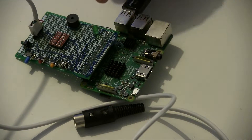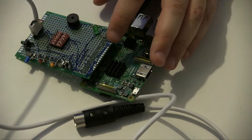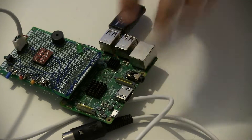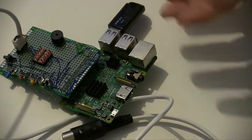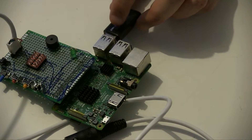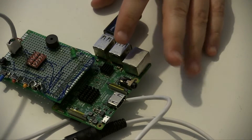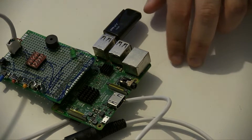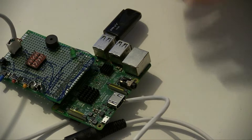There are two methods of loading disks from this device. The method I actually use is the image for the Raspberry Pi — I'll include the link to the project in the comments. This comes with a program called FB64, which is a file browser, and that means you can pick the images on the Commodore itself. The only issue is the Commodore doesn't like displaying lowercase; you can switch character sets by pressing Commodore and Shift. Otherwise you get odd characters unless you make all your files lowercase, which I actually did just out of laziness.